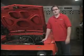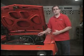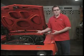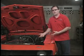Now, some of you are going to have cars that have vacuum advance distributors. And before you start, you're going to want to know if your vacuum advance uses ported vacuum, or what they also call timed vacuum, or manifold vacuum. Most of them use ported vacuum, but you want to be sure.